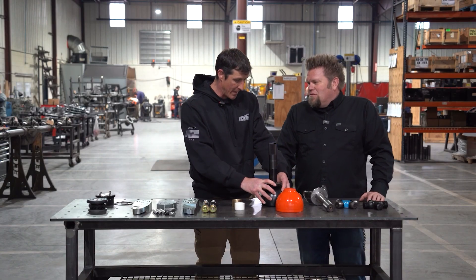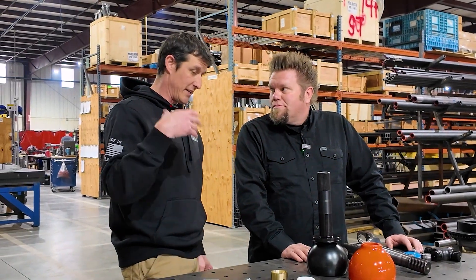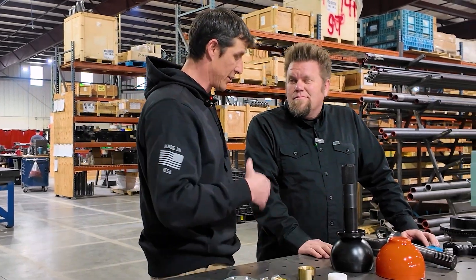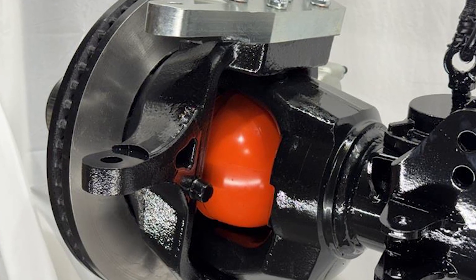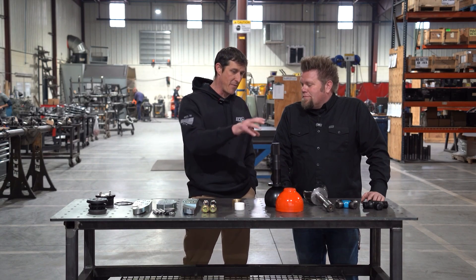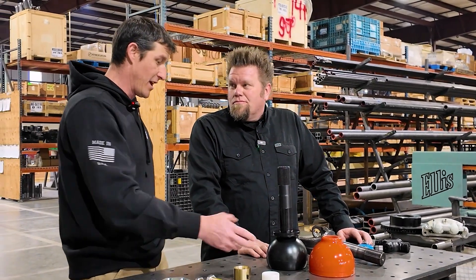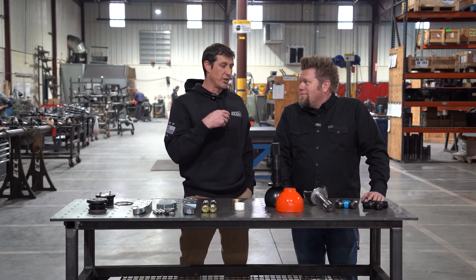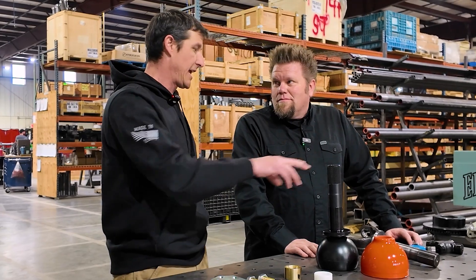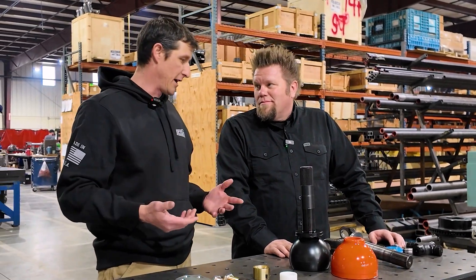Big enough for Big Bell — this is 4340. You could go to RCV and say you need it in 300M; you can do 300M inners, you can do 4340 inners. A lot of versatility depending on what you need. But keep in mind this is 40 spline, as is the inner, as is the bell. Once you get to a 4340 40-spline shaft, keeping everything else around it alive is very difficult.